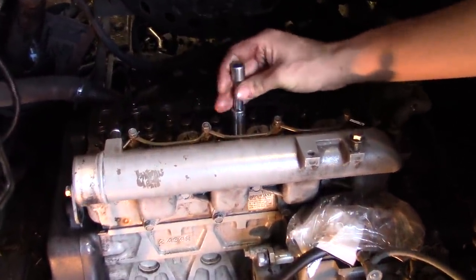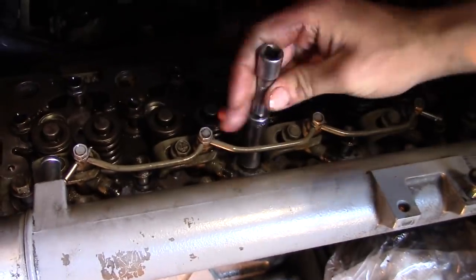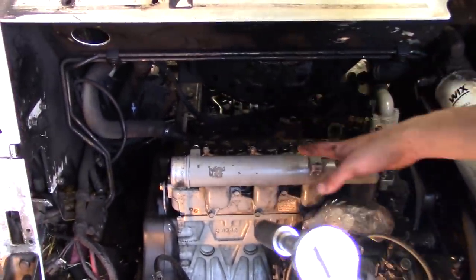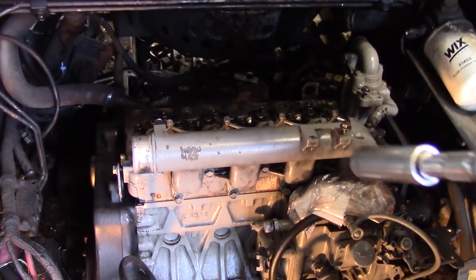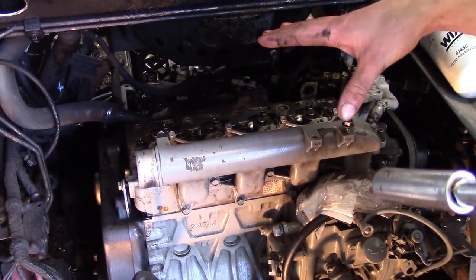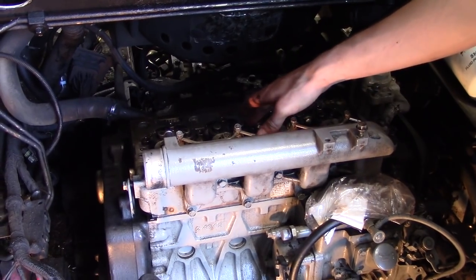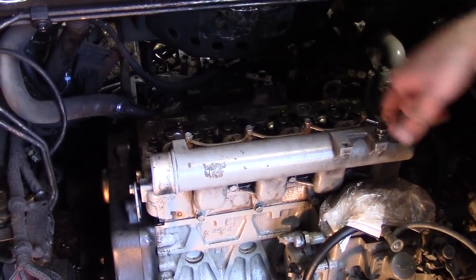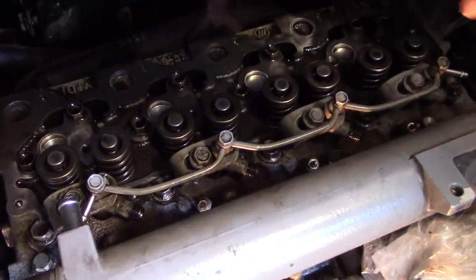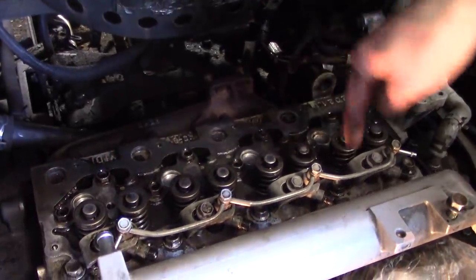I'm working on putting in the bolts by hand so that way I feel if it binds on anything — I know there's a problem before we go and torque it. I've got all the bolts in, they're not tight but they're just in. We're going to torque it — in the end we're going to torque it to 72 foot-pounds every bolt. I don't like torquing a head to that all in one go just because of the amount of pressure it puts in the center. What we're going to do is torque them to 35 and go all the way around. When you're loosening you're working from your way out inward, and if you're tightening you're working away from the center outward. That's what we're doing — going in a big circle fashion.